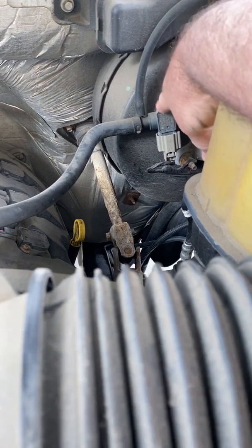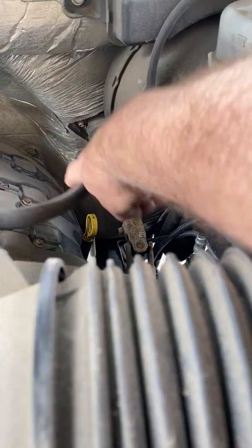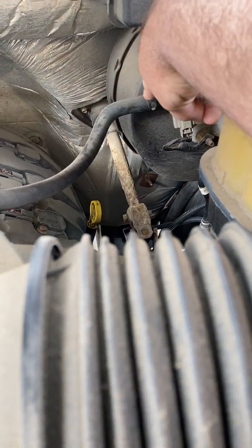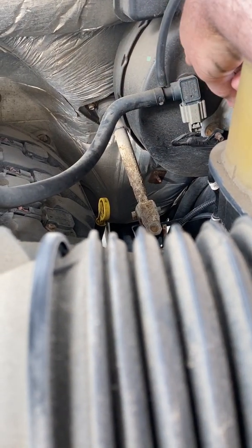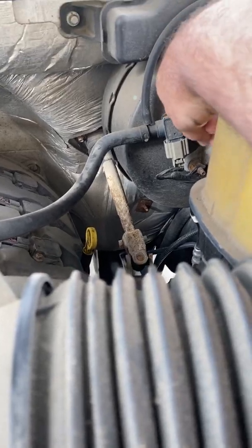So what we're going to do is apply a vacuum check valve right here. And so when I lose vacuum here, when atmospheric pressure tries to go back into this tank, we're going to shut it off here with this check valve. Now, why do we do that?